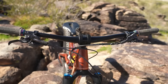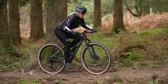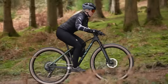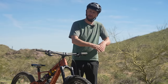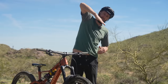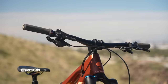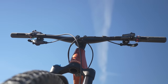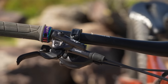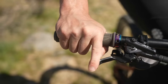You're going to want to flatten your levers. In XC, those guys are running a steeper lever — you spend a lot more time in the saddle, sitting up, upright, and you can get away with that old all-in-line feel. Bombing downhill, the steeper your bike goes, the flatter you want your levers. Also, with your controls, have a little experiment with where your brake levers sit both inboard and the actual lever reach. That's different for everybody — I run mine quite far out, while Neil and Blake run theirs quite close to the bar, which could be dependent on hand size.